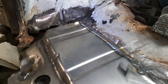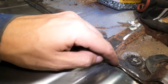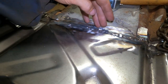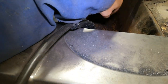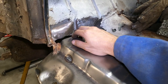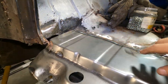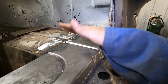I ground down the ugly welds over here and left the prettier ones. This is where I was saying the fit isn't that great, so I'm going to have to make a piece that goes in from underneath and tie this together. This got a little ugly in here because the material on the car side was a little rough. I stopped right here because I'm going to take the spare tire well out from underneath, and then I welded the other side — so it's welded in. I can probably just put a piece in here, weld it in place, and that'll hold this all square. Then do the same over here — tie this in somehow so it's at least sort of in one spot.